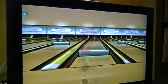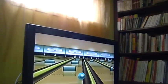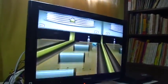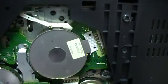So yeah, this VCR right now has a shaking picture. The picture used to be good, but right now the picture is shaking. So I will try maybe. No, the tracking does nothing. Oh no, it's not the tracking. This is the picture sharpness that I was adjusting. This is the tracking. No, it doesn't fix the shaking picture. But I think I used to test it while the circuit board was raised up, and there was no shaking picture. So that's odd.